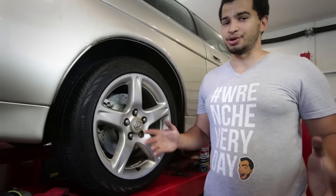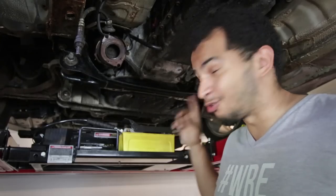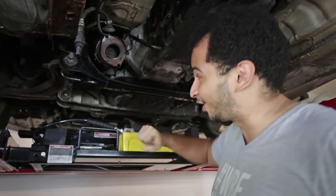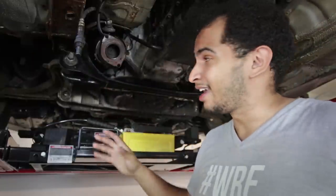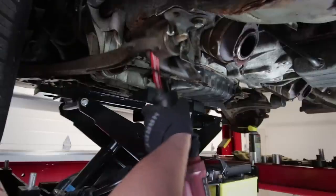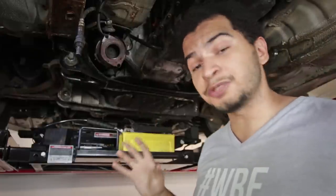But that's not the only part I didn't show you guys. My treachery apparently knows no bounds, because if we go underneath the car, you'll see that the rusty subframe that used to be here in two pieces is now replaced by a very solid subframe. That has all the bolts torqued to spec, everything has been cleaned up as far as rust, and I got new cam bolts because the old ones I had to cut out. All the alignment specs are set and it looks pretty good.